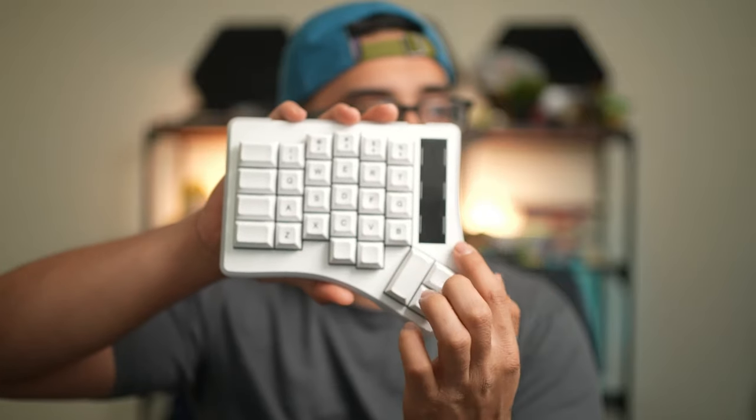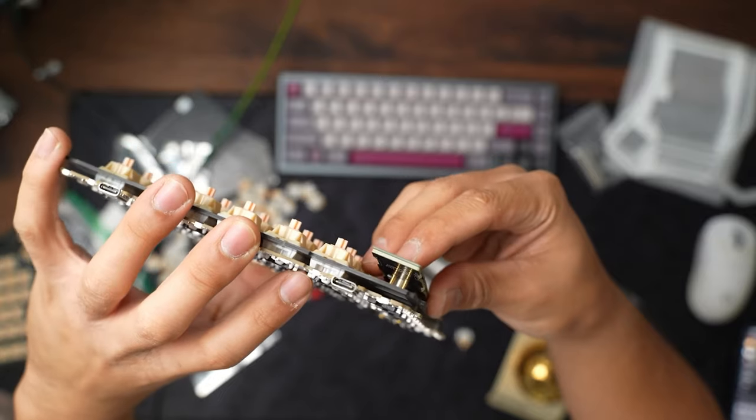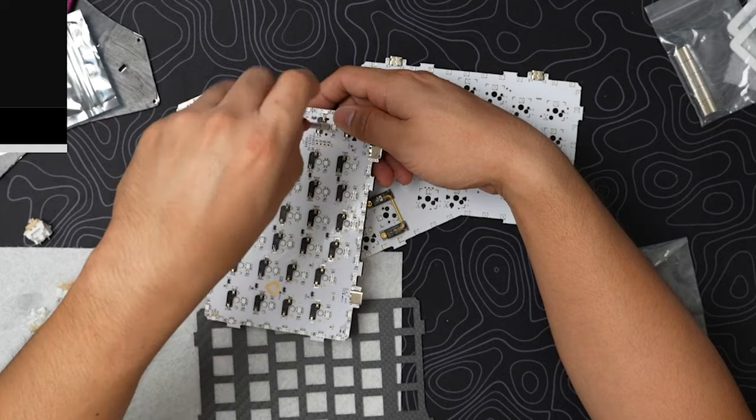The middle columns can be switched out for these touch bars or OLEDs, and it's pretty cool. It's a capacitive touch bar so you can swipe for volume and tap it to control a key. You can also change that to any key map you want and it can be controlled via VIA. And best of all, no soldering — it's a hot swap touch bar.